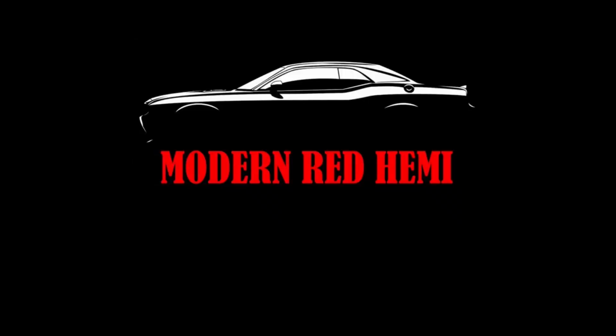But as you heard on Tuesday, we went from a belt issue to an injector issue that just kind of bounced down the line on the driver's side. So what I'm going to do is show you how to get to your injectors, what the injector looks like, and for my setup I got the 6.4 intake, so it'll be a little bit different than some of y'all with the 5.7 intake, but it's basically the same. There's just a couple spacers that you get with the 6.4 that you don't need for the 5.7. But we're gonna get right into it.